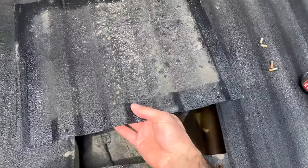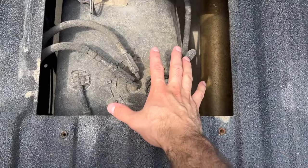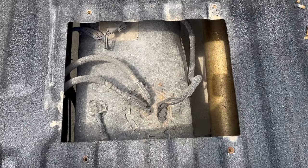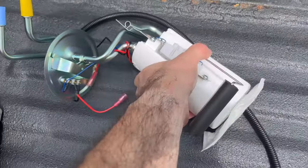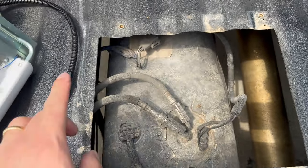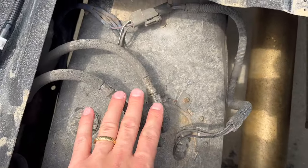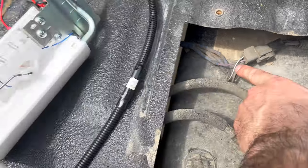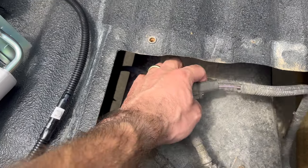Just for the haters, I've had this hatch for a while — no rust. Newer fuel pumps like this one don't typically come with the same pin connector that the original fuel pump came with. This is actually a fuel pump I replaced eight years ago, and I had to take this wiring whip that comes with your new pump and solder everything into place. We'll cover that in a little bit.